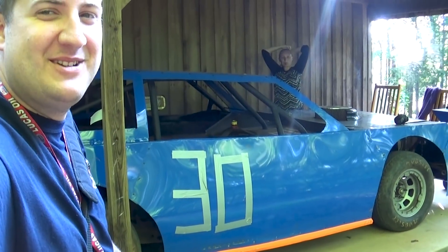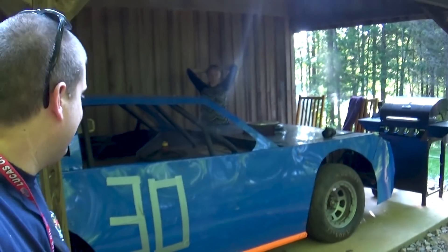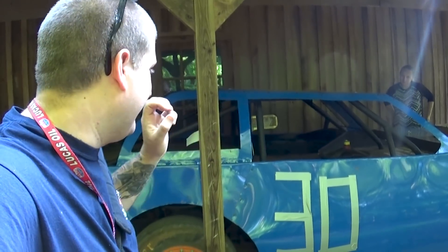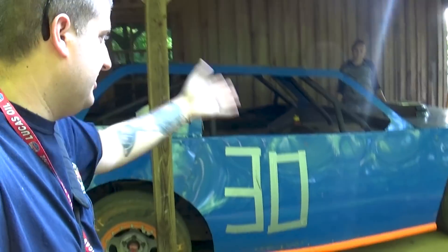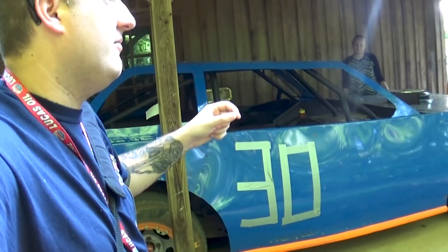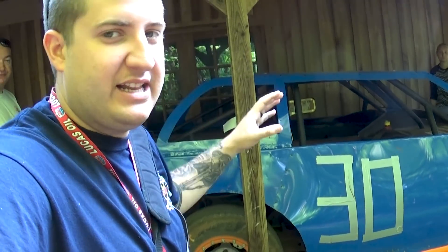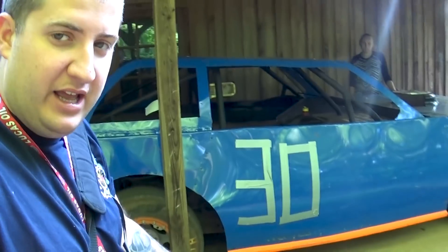Welcome to the video. I'm joined here with Josephine and Catherine. We're going to wash the car today and do a quick bolt check to make sure everything's good. Even though we only got about five laps on the car before we had an issue — what we thought was the clutch cylinder or hydraulic clutch wasn't that. It was actually the bleeder screw. We had tightened it down but it loosened back up. It was an easy fix, but we'll have to check it over and over, especially before we go to the racetrack.